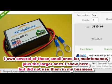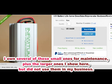Your voltage is key. A single cell in a battery is 2.1 volts, so a standard battery off a charge is going to be around 12.7 to 13.2 or 13.4 volts. If you have a battery that's going to be rescuable, you're looking at somewhere in the neighborhood of 10 to 10.5 volts. If it's below that, it's very difficult.